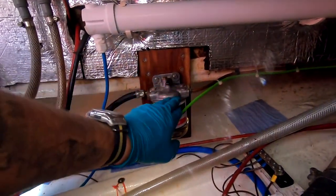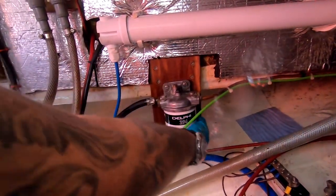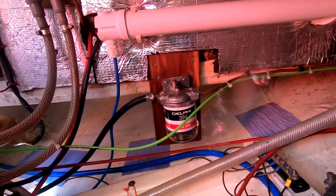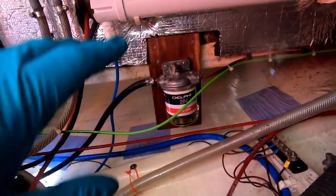There she is guys — sweet as a nut, absolutely bone dry all the way around. I'm going to leave the fuel on for 12 to 24 hours whenever I get a chance to come back, make sure there are no drips. I've checked the bilge — there's no diesel, well maybe a few bits, but I'll clean out the bulk of it. I am 110% confident that is fixed. I hope you enjoyed the video and it's been helpful for someone fault-finding a diesel leak in their primary fuel filter — you think it's going to be the big rubber seals, but it's that little copper washer that people don't look at. Cheers guys, thanks to my Patreon Blue Dog Oz, and I'll see you in the next one.